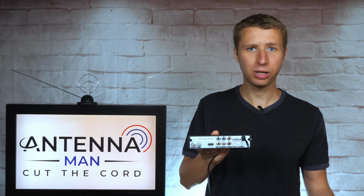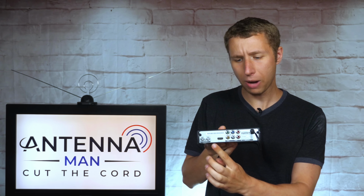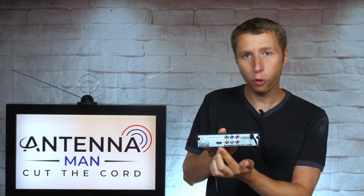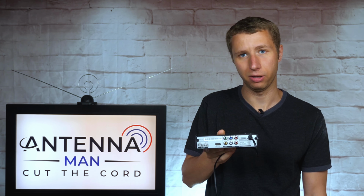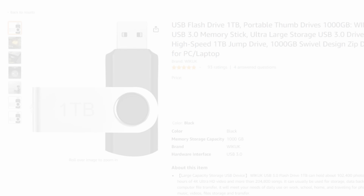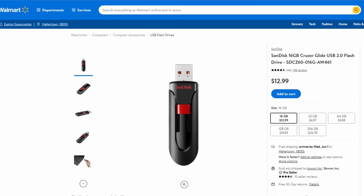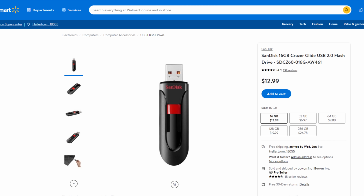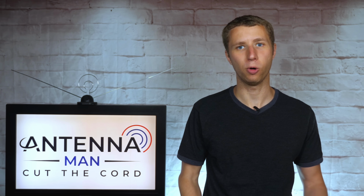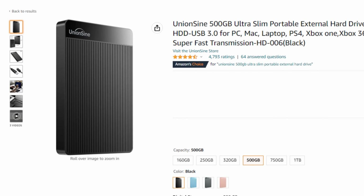I'd highly recommend using an HDMI cable as you will get much better picture quality with one. The coax and RCA outputs of this box are only standard definition compared to full HD with the HDMI output. I would also recommend using a USB hard drive, or at the very least a USB 3.0 flash drive for the recording function. Many flash drives at big box stores are only USB 2.0 and are not fast enough to handle the large file size of video recordings. You can find a list of recommended hard drives in the description of the video.